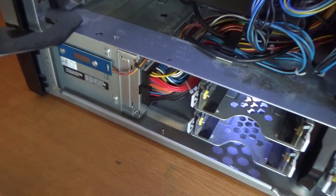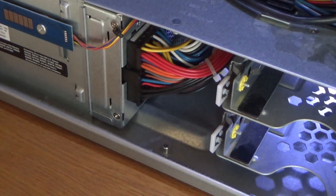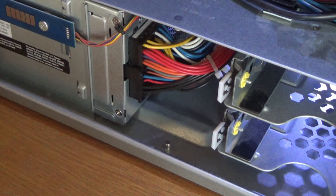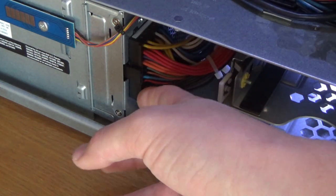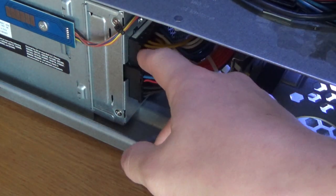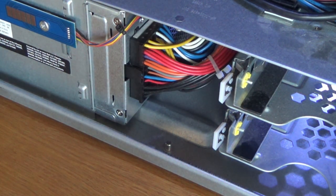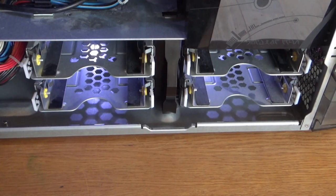So down here we have a weird thing, this is the power supply. The power supply, from what I can tell, is actually pretty standard when it comes to mounts. In the back, you have this sort of mounting device that you need to first screw onto the power supply itself and then mount it in the case, like some mini-ITX cases have, and I think it's the same here. You have this big pin here. This is actually a modular power supply. You can take out this pin and just take out the power supply itself, but it's just one big pin, so it doesn't mean that you can choose what connections you need, which kind of sucks. But yeah, it's an 875 watt 80 Plus Silver, new old stock, so you know it's good. Got it from Alienware as a replacement part, so it's never been used before I made this build, so that's really good.